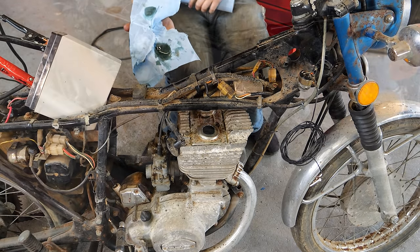It's gonna make this a bit of a pain in the ass in a unique situation, but usually what I do is I get a pressure washer, pressure wash as much of this tank as I can to break all of the rust, or in this case, paint loose, get it out of the tank the best of your ability, and then fill this sucker up with some form of evaporust or something to that extent. I still suggest putting a filter in line, because even though it gets everything, it never always gets everything.